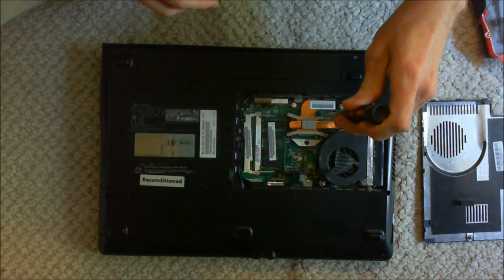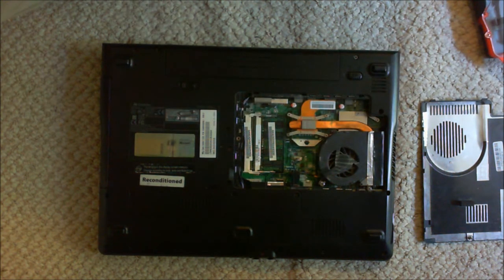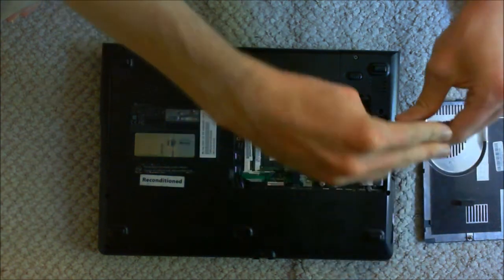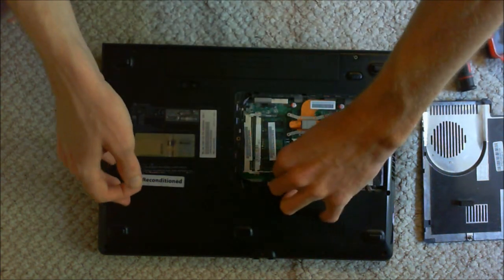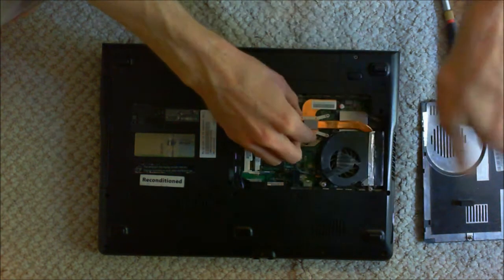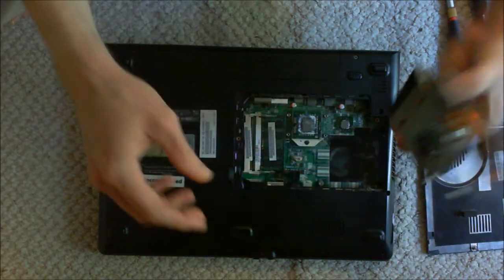So we've got one, and then two, and then over here to three, and then four. That's one of the convenient things if you have a magnetic screwdriver — it can help you immensely in taking screws out or putting them in. I'll go ahead and take off that screw there, and then remove this one over here. This is the plug that powers the fan, so we can just pull that off. Carefully lift — it's kind of tucked underneath there, and it looks like this screw is still sticking, so let's give that a little more loosening.